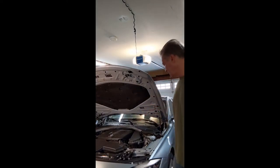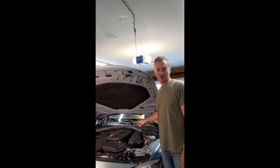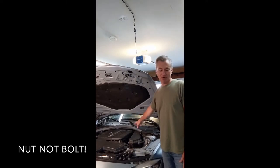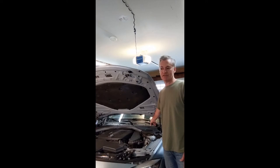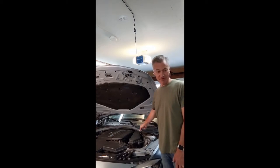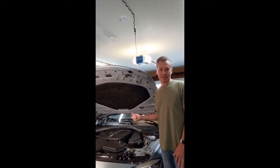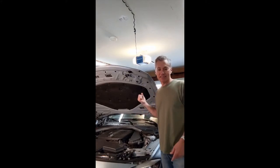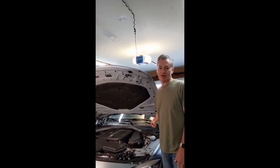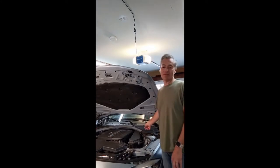I have the replacement in a box. I watched a bunch of videos on YouTube about doing this, and the first problem I ran into - and I think this is the hardest part of this job - is getting these windshield wipers off. They're each held down with a bolt, and once that bolt is tightened, the bottom part of the arm gets stuck onto the nut so far down that it's hard to get out. I had ordered a removal tool from ECS Tuning, which they recommended when I bought the cowl, but it's not big enough to fit around the bottom part of the arm. So I had to send it back and told them to stop recommending it, because a lot of people on there complain about it.